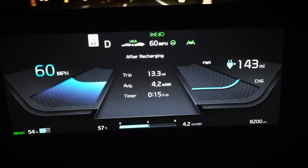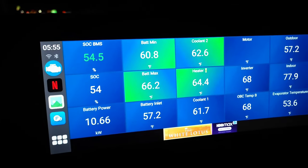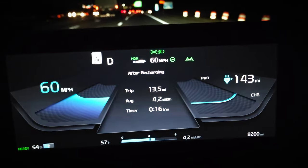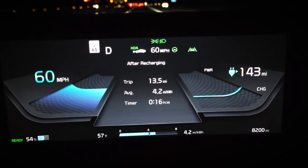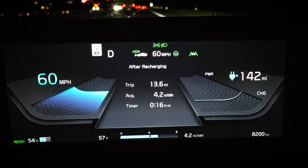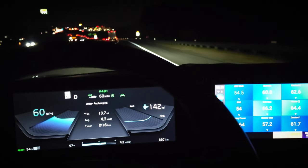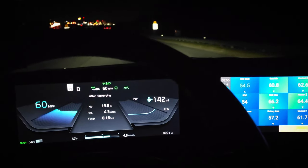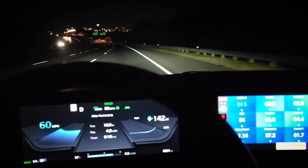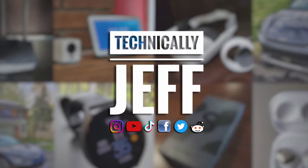Overall I'm very pleased. I was thinking of a drop of maybe 0.3 miles per kilowatt hour at 70 mph and 0.2 at 60, which still wouldn't be horrible — that would only be a drop of about 20 miles of range at 70 mph. But with it only being 0.1 miles per kilowatt hour lower than the stock wheels, it's only around seven miles lower range, which is very minimal. And now I have wheels that look so much better, and since they are so much lighter, the car has better handling, acceleration, braking, and will generate less wear and tear. I hope this was helpful — let me know what you think in the comments, and thank you so much for watching.